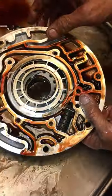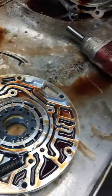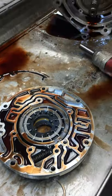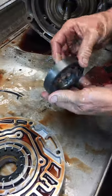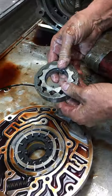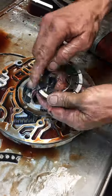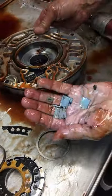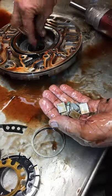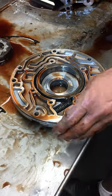This is the vane pump I was talking about — this isn't your normal style pump. It's got these little paddles that turn. They also make variations of these pump gears. Your 48RE Chrysler, 350, 400, and C6 pumps all have the gear style. But this is a vane pump — there are 13 of them here instead of 10 or 8. You have a guide that keeps it centered, along with your rings, and all these little paddles that set in here. That's basically how your pump works. They're really good and they last a long time.